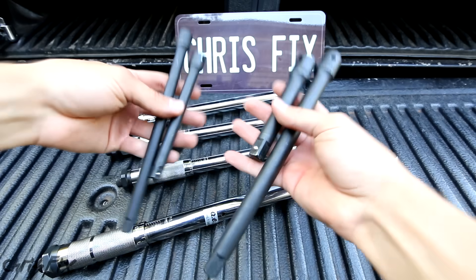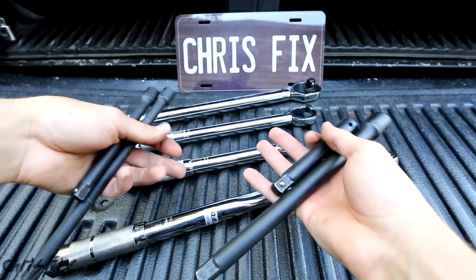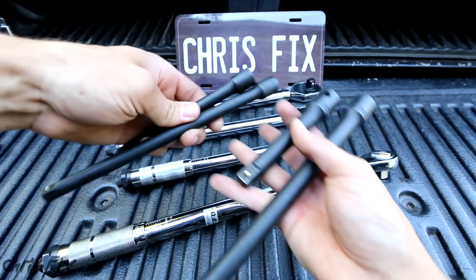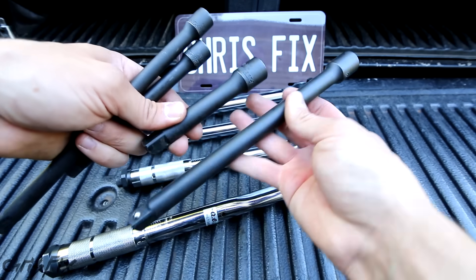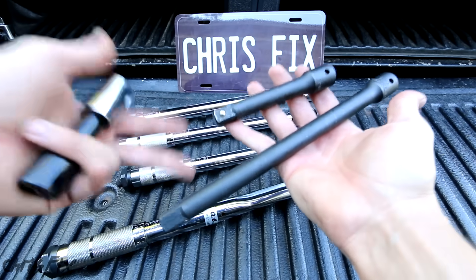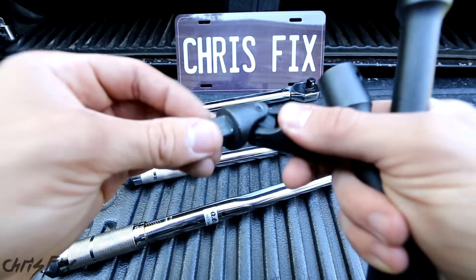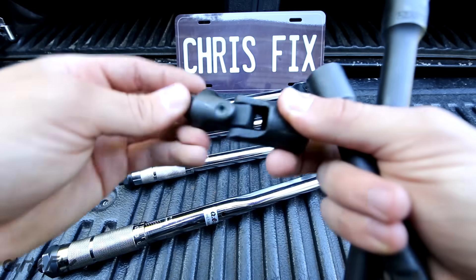Now another top tip I have is using extensions. A lot of people are like, you can't use extensions with torque wrenches because then the torque won't be exact. Well, that's not completely true. You want to try to use thicker extensions. You can see these are three-eighths inch extensions, so they're more likely to have a little bit of twist to them. But these half inch extensions take a lot of force to twist. You have to realize, when you're working on cars, sometimes you have to use extensions just to get to the nut or bolt. The extensions that you shouldn't be using when you're torquing stuff are universal joint extensions that have a lot of play in them, and also wobble adapters or wobble sockets, which have a lot of play in them, because this will mess up your torque reading and torque spec.